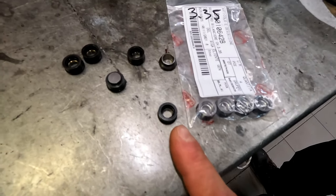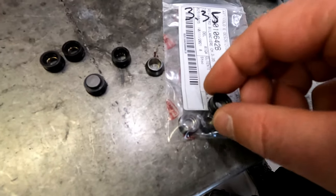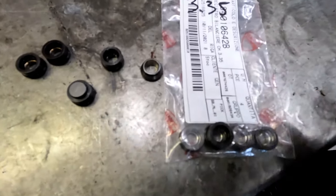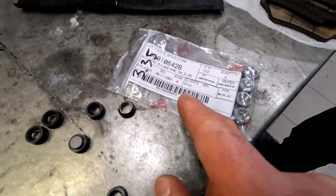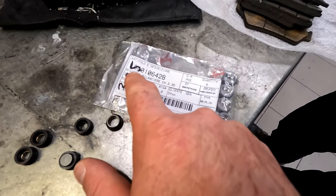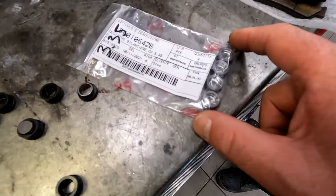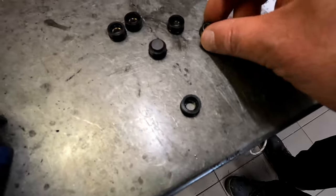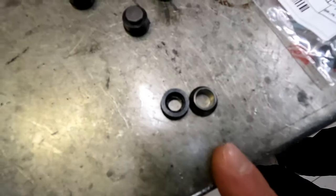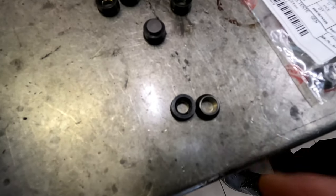The Panigale, being a race bike, has a totally different part — it looks almost the same from outside, but the inside dimension differs. For example here it's about 3.35, so the opening is much bigger. The Panigale's valve opening is wider as well — it's a high-power engine with over 200 brake horsepower.